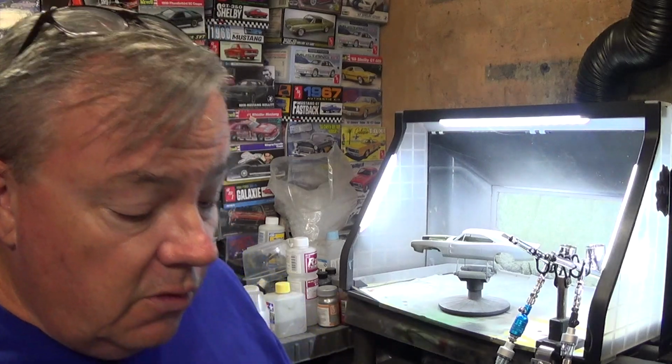That's why you want to test. In this case, I had already sprayed this paint onto the other parts, and it was thin properly. It's never happened to me except about 3 years ago with one particular bottle of paint, but I should have spotted it before. With pre-thinned paint, that's why I recommend you always spray off your project before committing, because if the paint is too thick and your PSI is too high, you're going to spider web, even though it says it's pre-thinned.